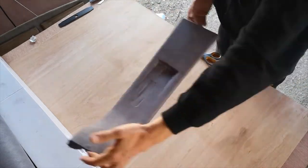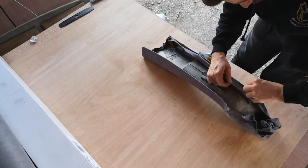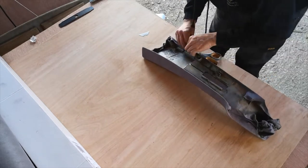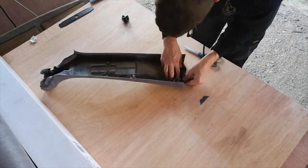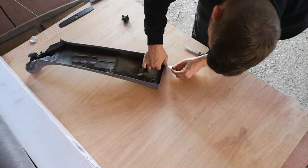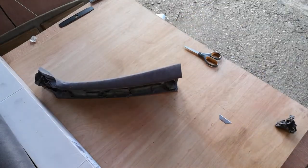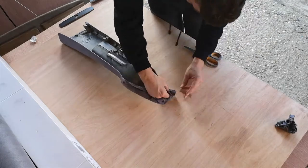Tucking in all the time, checking your work. Once you're happy, you can then get in there with a Stanley blade or scissors and start removing the excess material that you've left behind. Cut carefully, allowing yourself enough material to lip over the edge, which will give a nicer finish when you inspect the panel up close.